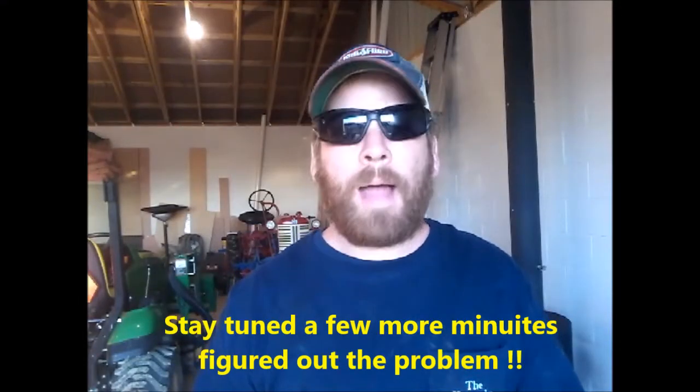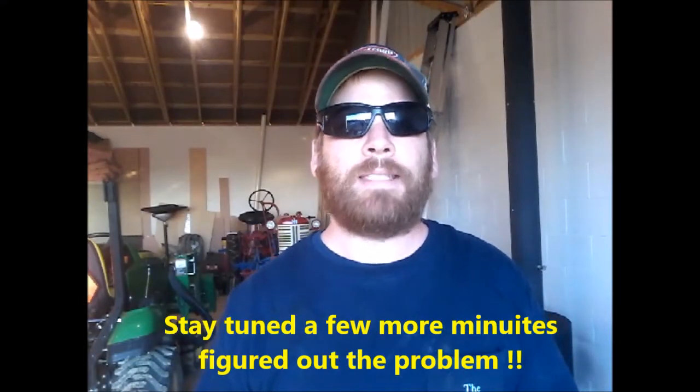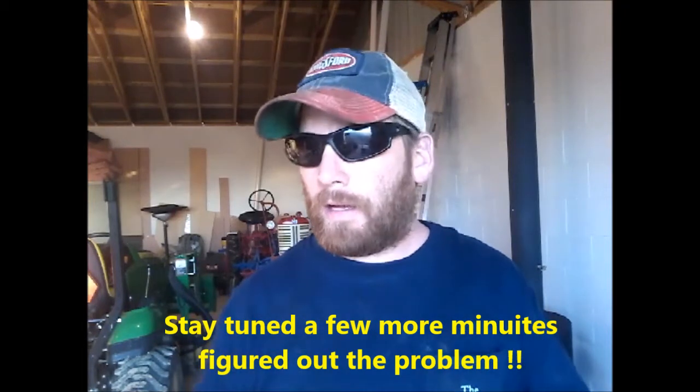That's it for today. I got out of time — and when I say we, I mean me. I'll go back and do a little research on the timing and see what the deal is, and we'll get it timed and running right. I'm sure it doesn't lack compression because that thing is hard to even turn over when you go to start it — that's another indicator it might be a little out of time. Don't forget to subscribe so you can see the next part of this video.